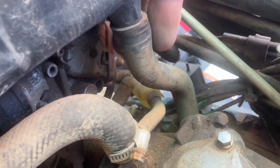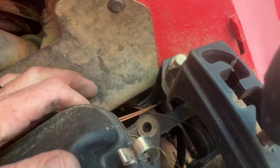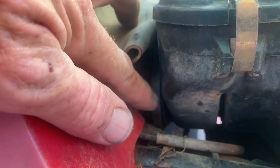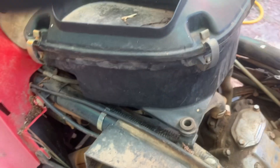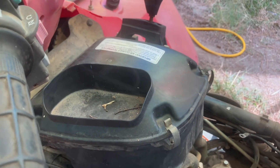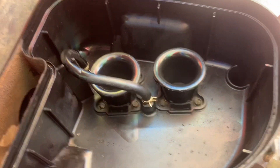We've got the little air breather off. There are vents that come up — that clip's already gone. Something is still connecting this and it feels pretty tight. I've got this hose here loose, but it's still connected on the carb side. I'm going to have to go inside the air box. We need to release the box from the carburetors — looks like four 8-millimeter bolts.